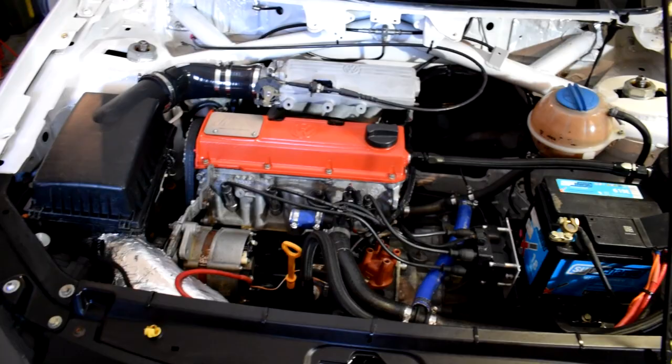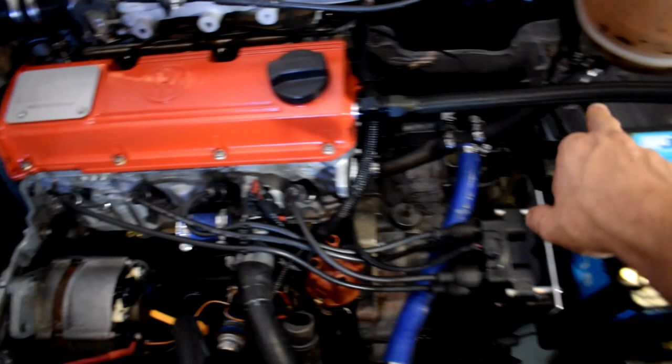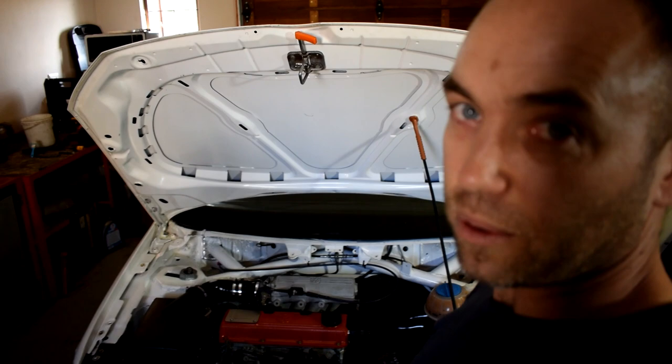Also, I designed and had this fabricated, this air breather system. So a breather comes from the crankcase, comes around and goes into the side there. Also, we've modified the valve cover, and we take a breather up from there into the catch tank. There's a lot more little things we do to these engines to make them reliable, number one, but also competitive, and we build them obviously exactly to the rules. And I'm very, very happy with the way it's turned out.